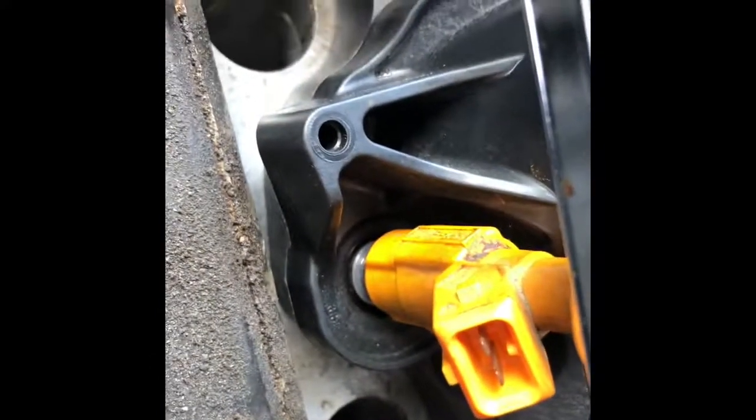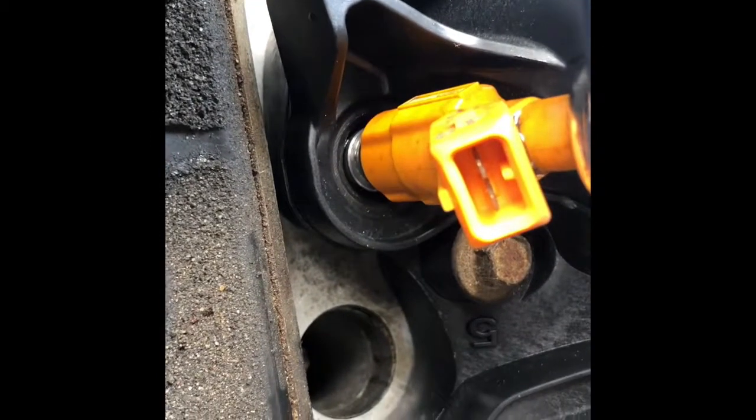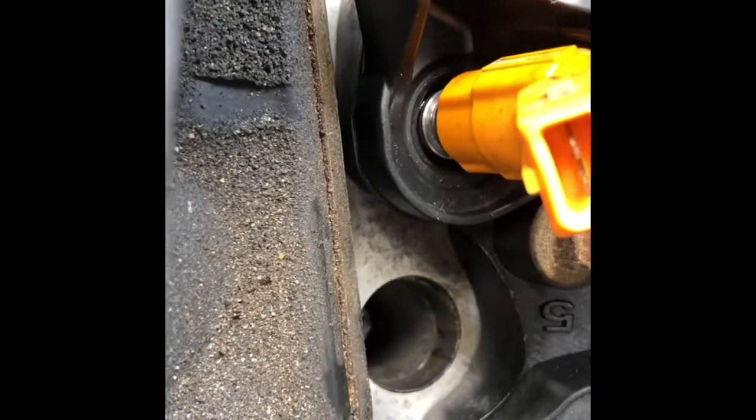They don't really get as dirty as they seem to show you in some of the commercials for various different products. Fuel rail and fuel injectors are all clean, and I set them back up in here. It was actually pretty easy to get them in. You just pushed a little bit, and I didn't really even need to rotate much. I did use WD-40 on the new seals, put a little on each one before I popped them in there, and they pretty much slid back in.